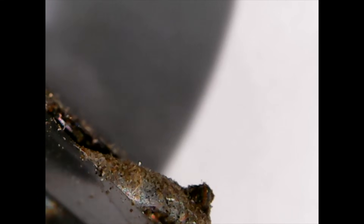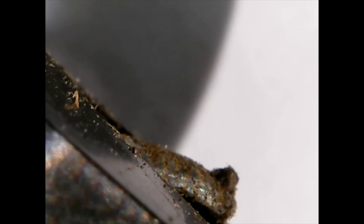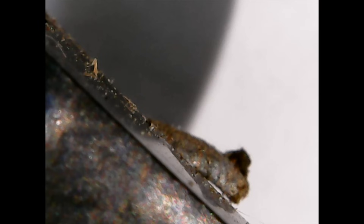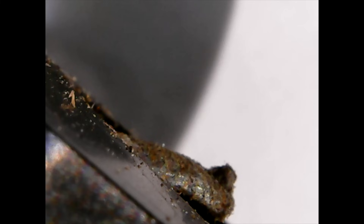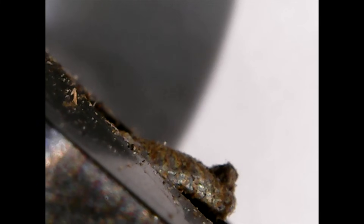Let's take a look at the Stanton, which is extremely dirty. As you can see, the diamond tip is completely covered in dirt and it's very large and very flat — this is because it's for shellac records, for the large groove of shellac records. Going instead to the Denon, you can see this nice shot of the diamond stylus of this mono cartridge, which is still in very good shape. In fact, I've used this very, very little, so there's a lot of life still here.